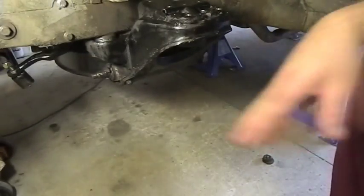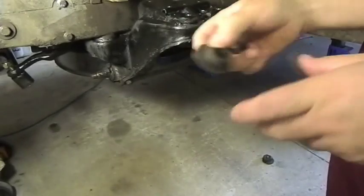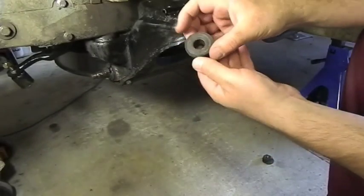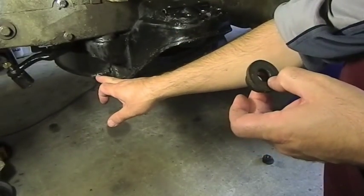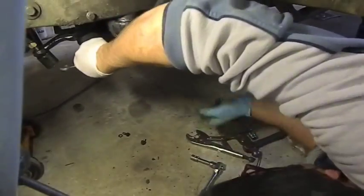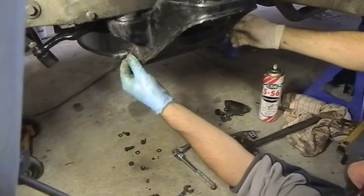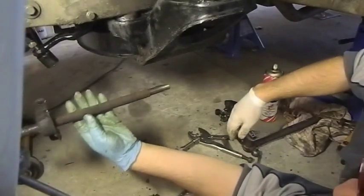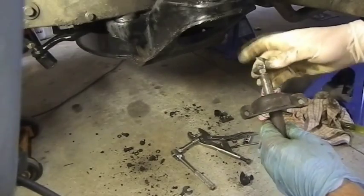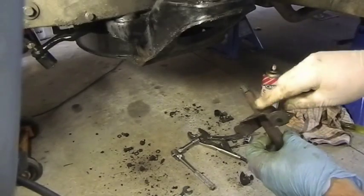When I first looked at these lower control arm bushes, they looked alright. But the more I investigated, the more I found that they were actually shot. Now the problem with these - these are the steel inner type - the steel inner tends to rust onto the shaft. This is a big stubborn pain in the neck. I'm going to take this whole lower control arm pin out. Hopefully it all comes out as one - I've never taken one of these off before. That really was a bit of an ordeal. I've had to cut diagonally with the Dremel into there and knock it off with a cold chisel. Just got to make sure you don't cut too far because you don't want to cut into this surface. So I'll clean all that up with wet and dry.